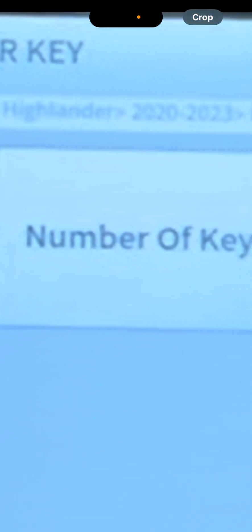In the X-Tool D7, I went to the Special Functions menu, then Key Programming, then Smart Keys. I selected by model: Highlander 2020 to 2023. Then I selected "Other Key" because it's an aftermarket key, not an X-Tool or OEM key. That brings you to a menu where I wanted to erase keys first and then add two new keys.